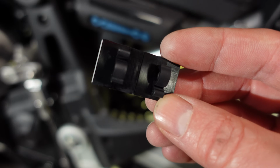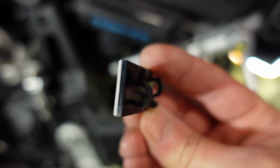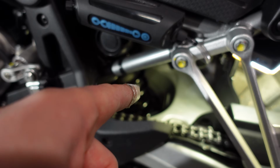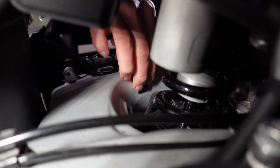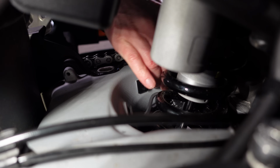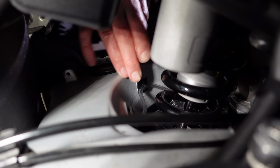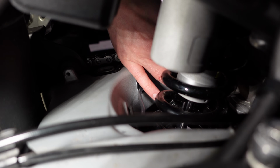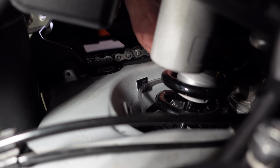And then in the kit we've got these little sticky back hose clip thingies, and I'm actually going to stick two of them in there just to give me a bit of redundancy if one should fail. Peel that off, stick one there, give it a nice firm push, and the second one there on the flat bit. Push the hose into the clip. Same with that one. And that is now hopefully nice and secured, and that shouldn't be able to go anywhere near the shock absorber there.